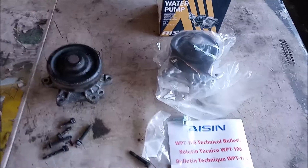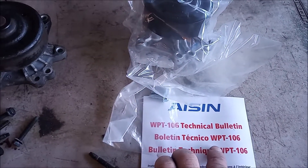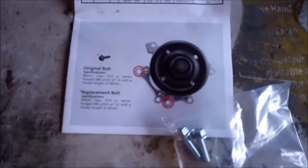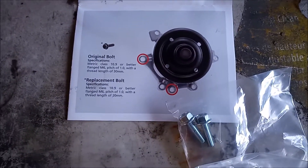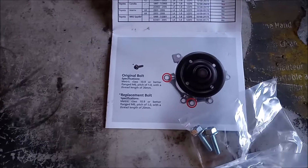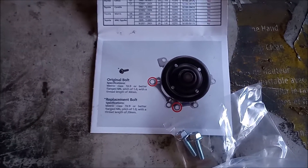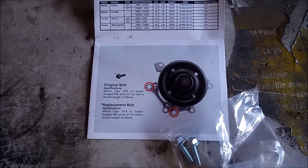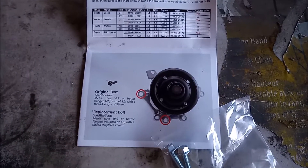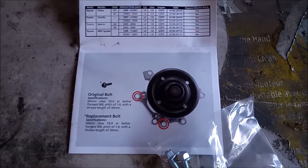It's an AISIN, which is the OEM brand. One thing I want to mention is this replacement water pump comes with a technical bulletin — let's look at what that's all about. This bulletin basically states that there is a difference in the construction of the pump and it requires that we use different bolts that are provided in the kit. This is something you'll see in a lot of aftermarket pumps: the thickness of the flange on the pump is different from the original pump. I don't know why that is, but that's how they are made — probably so that they can fit a wider variety of vehicles. So be aware of this, because not every aftermarket pump comes with this bulletin.